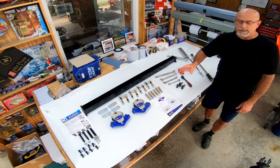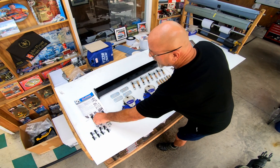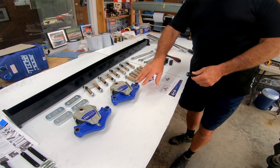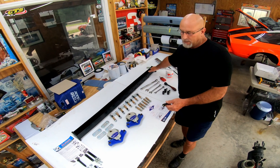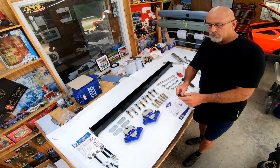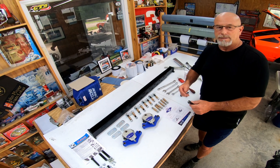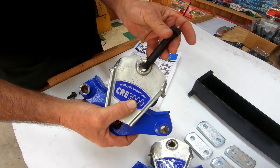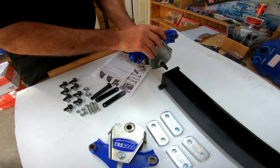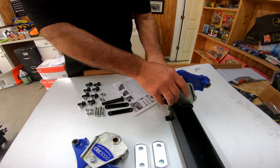On this job, when we do the installation, we're making one change. Because we're using the X-Brace, we're going to swap out the wet bolt that comes with the X-Brace in this top position here, in place of the bolts included with the CRE 3000. Because of the design and thickness of the cross brace where it bolts on, this is a longer bolt, and that's why we're making that swap. The Zerk fitting will face to the outside of the trailer. All the rest of the Zerk fittings will face to the inside of the trailer for ease of lubrication. You're going to use the bolts included with the crossmember brace from the outside with the Zerk fitting facing outside the trailer. Then that keys into the hole on the end of the X-Factor brace, and your nut goes on the inside. We'll show you that once we're installed underneath the trailer.